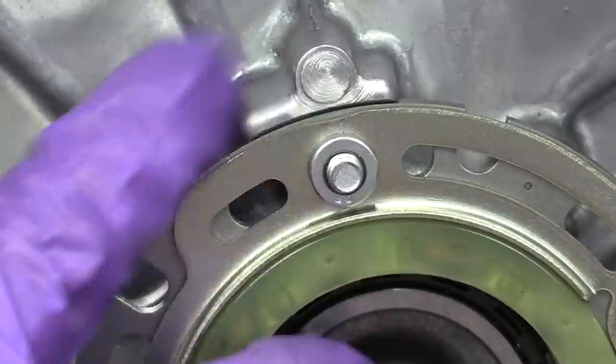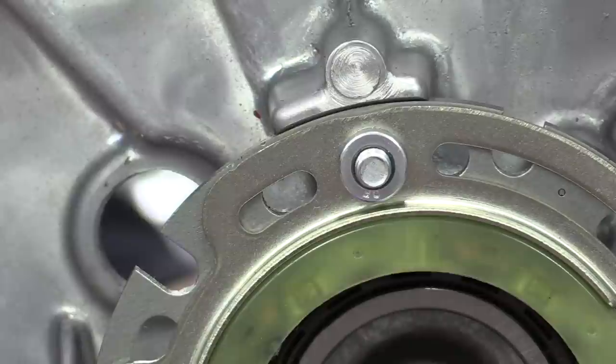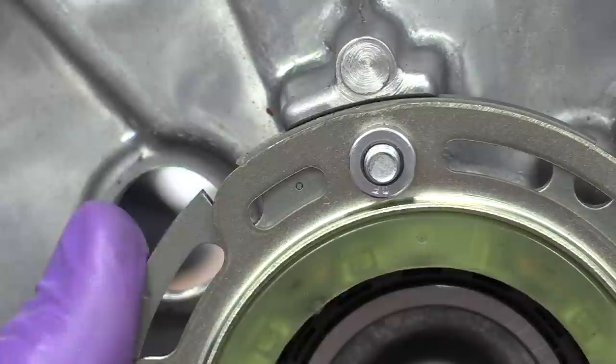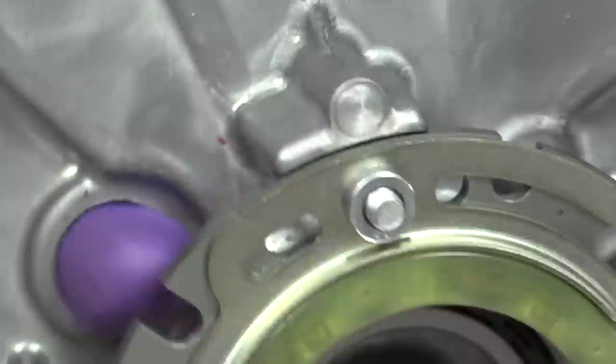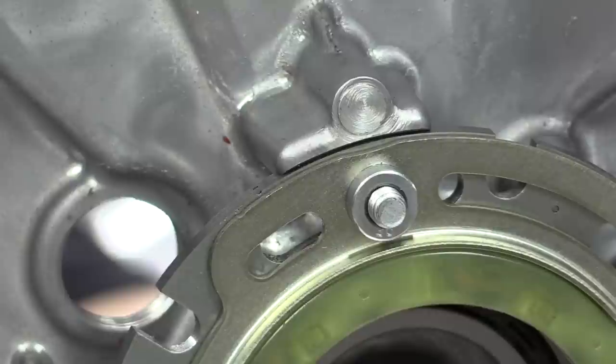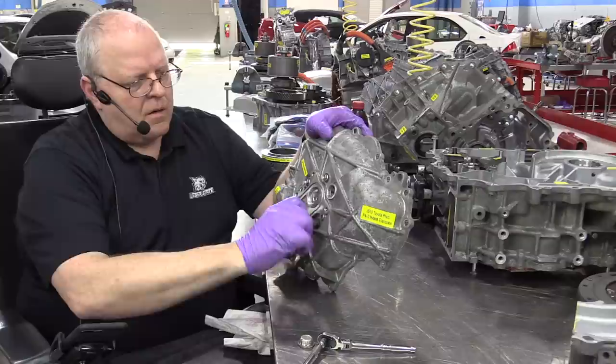And if you center that notch, the best you can, over that hole, that's where the scratch marks had it lining up to begin with. So it can be adjusted way down or way far the other way. Put it dead center, look through the hole itself, line it up, because I'm sure that's where they make any fine-tune adjustments. They come in and pry it one way or the other for factory calibration.